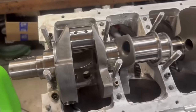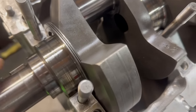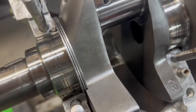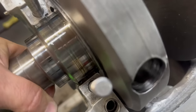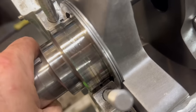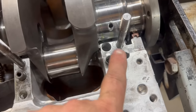The roller thrust bearing went right on — it is captive, got about two thousandths of end play. You can see how nicely he machined the snout and bob weight of the actual crankshaft, and he machined the block. There's play, and then when it starts pushing, I imagine what will happen is these races will kind of lock down on the surfaces and the roller bearing in the middle will take the load. Back here in the back it's going to ride on this thrust, which is what keeps the crankshaft from going backwards — and there's nothing pushing on that at all.